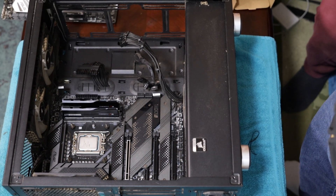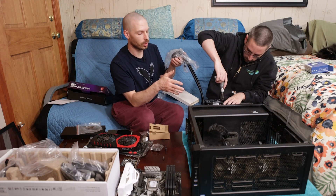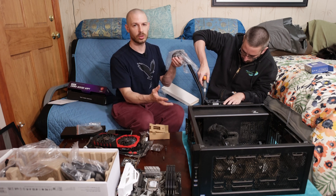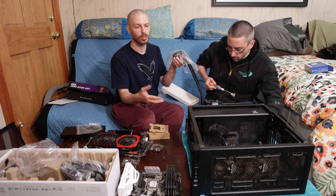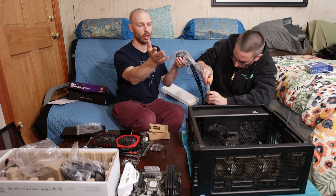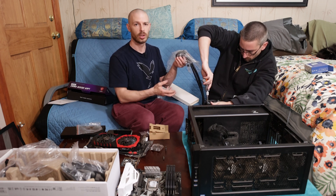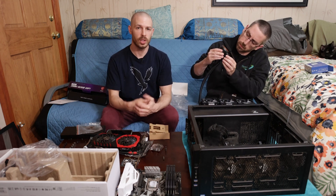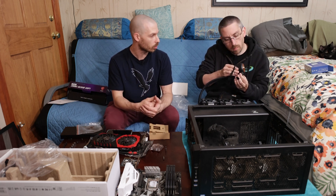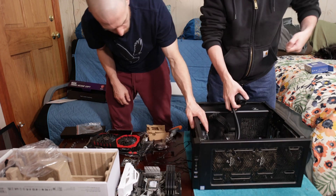The motherboard is mounted and now it's time to do the liquid cooler. The way we set up the computer is with the radiator on the front, pulling cool air in through the radiator to cool it off, while fans on the back and top exhaust heat out — heat naturally flows upward and exhausts out of the system. It's a pull-and-push system. Now we have the fans mounted onto the radiator, so it's time to mount the radiator in. Then we'll need to apply thermal paste before mounting, and twist it so the dragon faces the right direction.